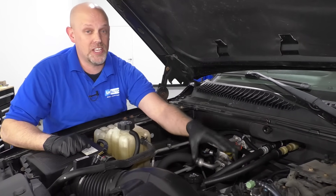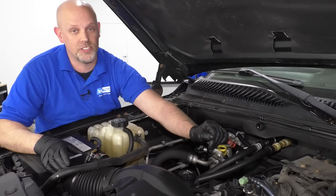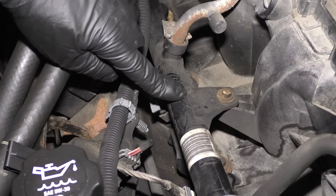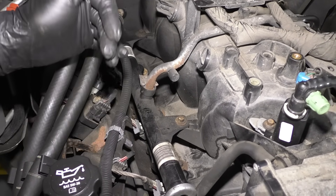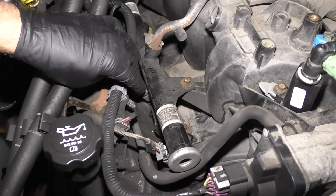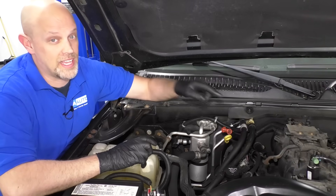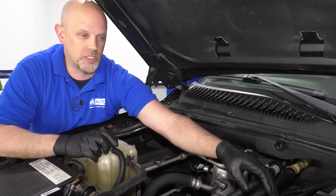Everything we've talked about so far has to do with the engine getting air and everything being sealed up in the intake system — everything after the mass airflow sensor has to be sealed up to the engine. There could also be two additional problems that could cause this code: a fuel injector issue or an O2 sensor issue. Your fuel injectors are located right here, attached to a fuel rail, and there needs to be a certain amount of pressure in that fuel rail. If that pressure is not high enough, your air-fuel mixture is not going to be correct, and that could cause that code. If the fuel injector itself is plugged up and not letting enough fuel into the engine, the engine isn't seeing enough fuel — it's trying to add more and is unable to do so, which sets that code. Related to low fuel pressure, you could also have a bad fuel pump not putting enough pressure, or a fuel filter that's partially plugged up.